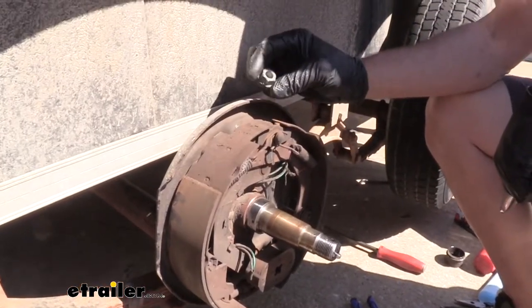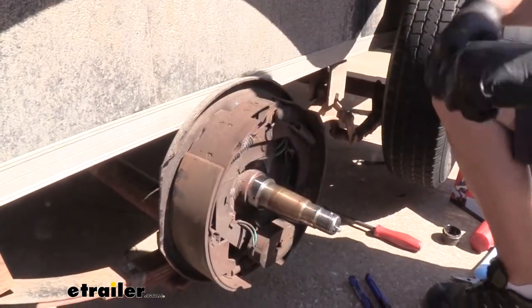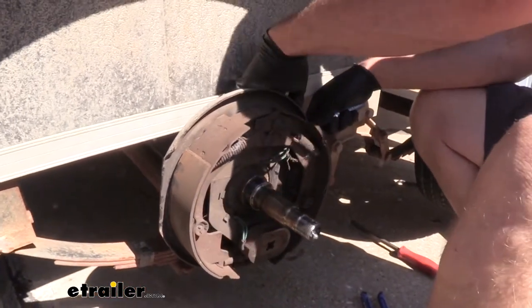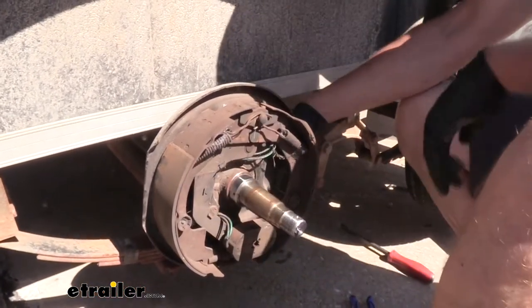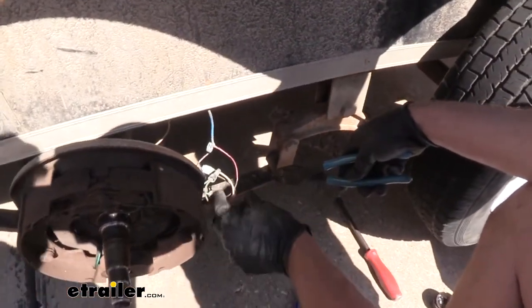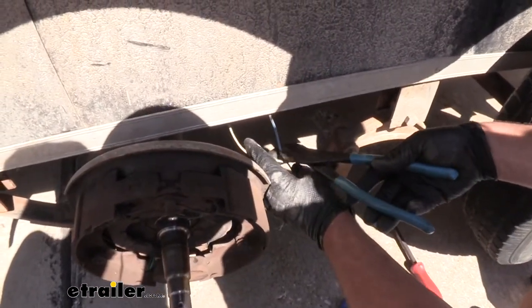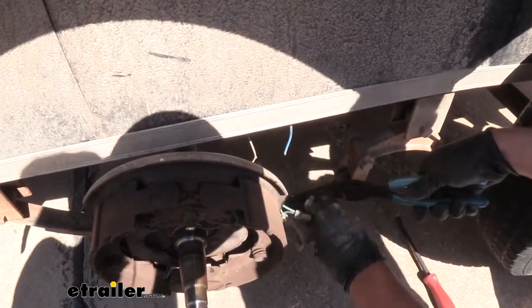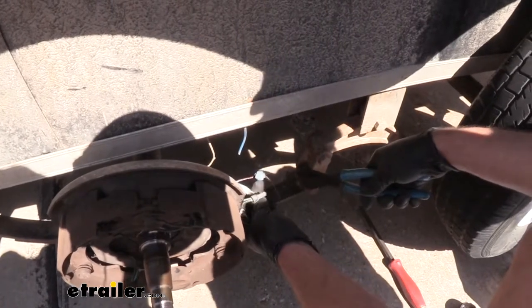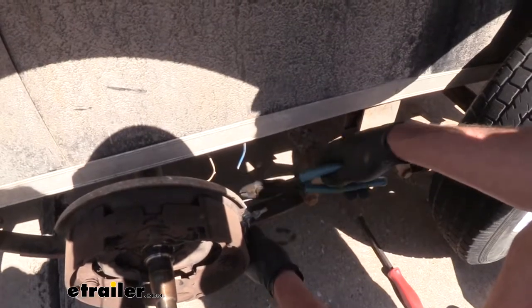You can see here's what our hardware looks like — it's the flange nut. Ours uses an 18 millimeter, but a lot of times a 9/16ths is probably going to be what you need, so just check it out and see what size you've got. Before you pull your last bolt out, we need to get our wires separated here. Looks like these are going to be the two that come in from our plug. You can see they use quick connectors there, which we don't recommend. They use those to go across to the other axle, so we'll have to splice all these together — we'll show you that in just a minute.